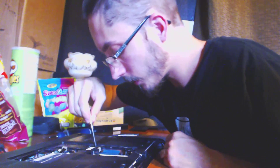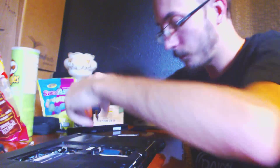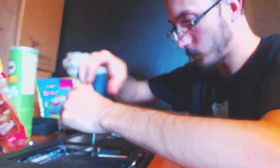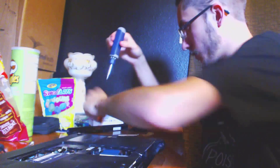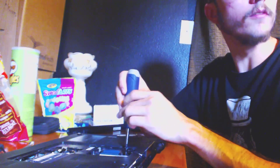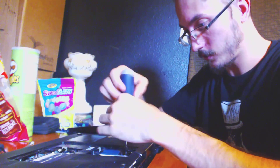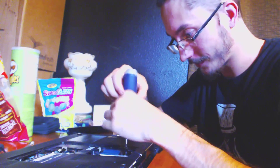Now I'm just removing the screws that are in here — I did forget to do that. That's very important to do because if you start pulling it out you're going to wind up damaging it. It's always good to be working with a lightly magnetic screwdriver bit, because you don't want any of the screws falling down on top of the components. Because if you lose those screws — well, they're kind of screwed. No pun intended.